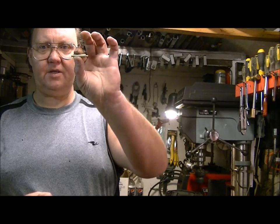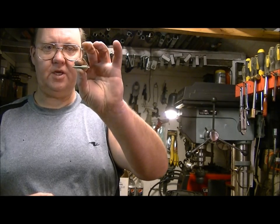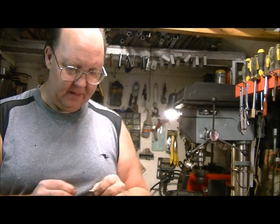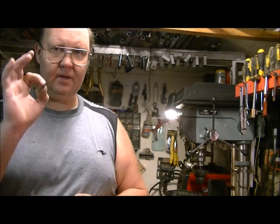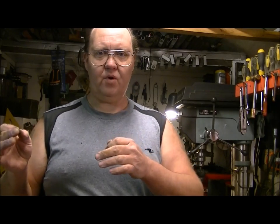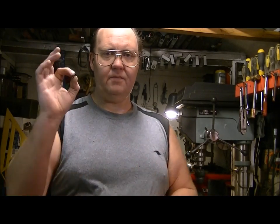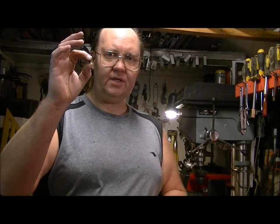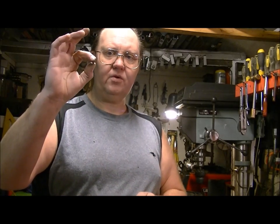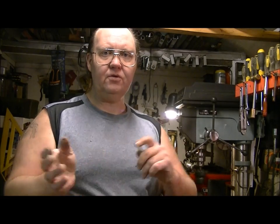A tool like this for doing both calibers is going to be about $15 plus postage or shipping depending on how you want it sent. Now if you're boring your transfer port out, I need to know that because you're going to need a different tool — once you bore it, it won't fit on the standard holder. I only bore these transfer ports out to a maximum of 3.95 millimeter, so I accommodate for those two sizes only.